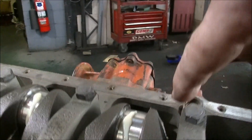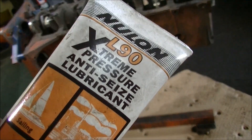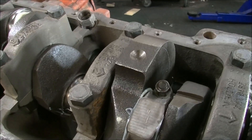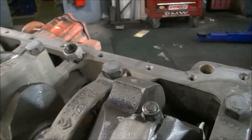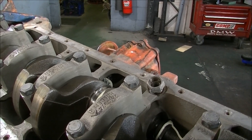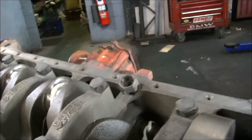In case you're wondering what I'm using to assemble the engine — I don't put it on the rings, I just put it on the crank and the gears. The only thing I suggest when you're putting pistons in — if you want to be absolutely sure you haven't got an issue — each one that you put in, give the engine a turn. It costs you nothing. Because if you put them all in and torque them all down, and then go to turn your engine and it doesn't go, you're going to be thinking: which one is it? At least if you do it as you go, if you turn every time you put a slug in, you give it a swing around — you know there's no issue there.